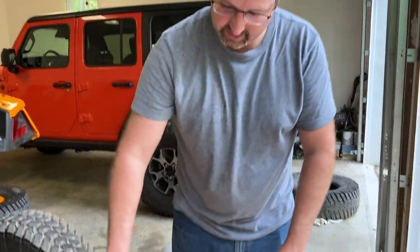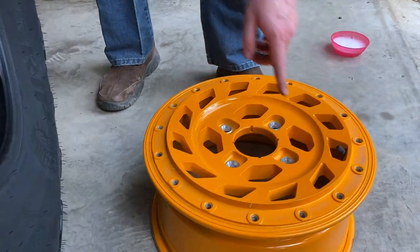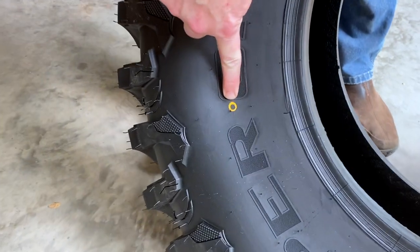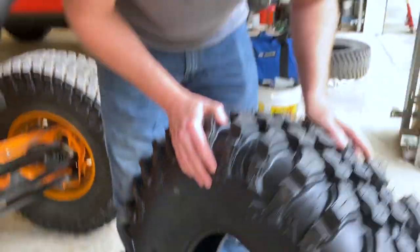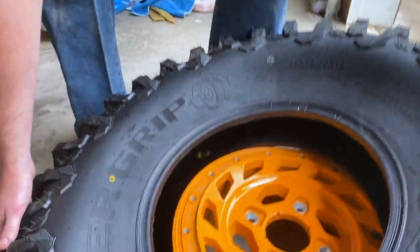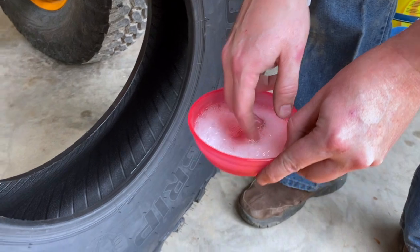For the last step of mounting, set the wheel with the bead lock side going in first. Make note of where your valve core is — on the new tire there will be some kind of marking or indication that goes exactly opposite the valve core for the most optimal balancing. It also helps to get some soapy water and run it around the rim before you go shoving the tire on.